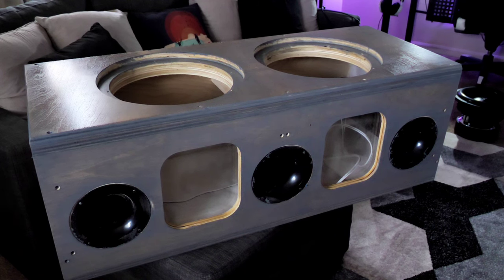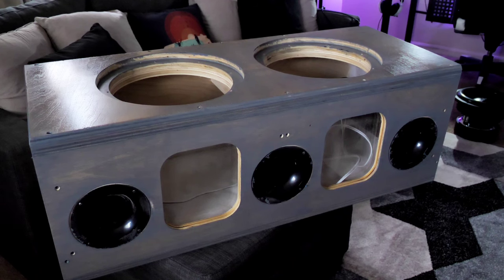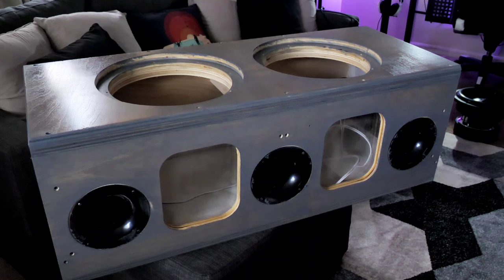This is tuned down to 30 Hertz right now because I like to play it low — most of my music gets pretty low, so I want the most output around that area. I also took out the polyfill that was in the old box and placed it in this one. The perfectly spec'd box for the BXS was a little too wide to fit in my trunk, so we made a slightly smaller box. Adding the polyfill should make it play a little lower and make the speakers feel like the box is a bit bigger.